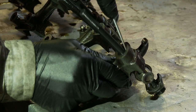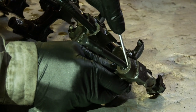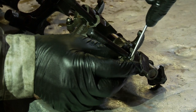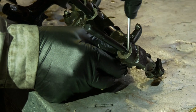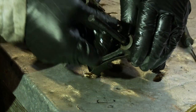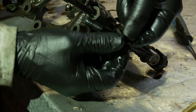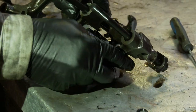In the head gasket set that you can buy, these new replacement O-rings come with the set. Here we can see that the O-ring is almost so hard that you can just bend it and break it — I need to do that with all of them. The new O-ring, which is lovely and pliable, just goes over the thread of the bolt. Once it's in place it stops this assembly coming apart. Hence you're back to an assembly that doesn't really come apart — it's all a bit loose but won't actually fall off because the O-ring stops it coming apart.